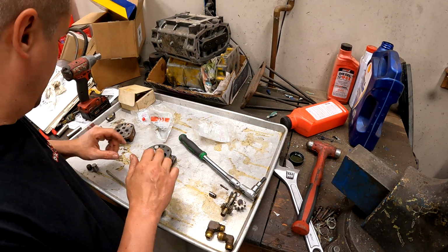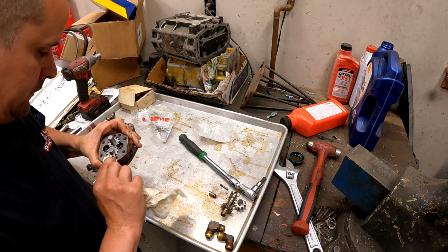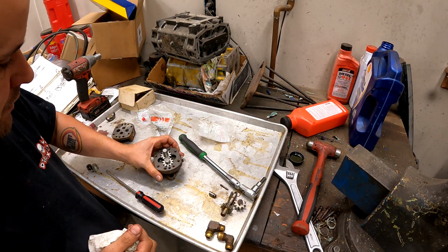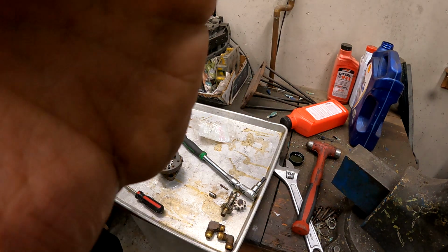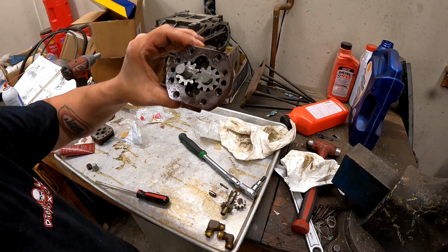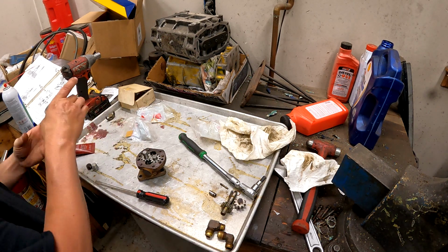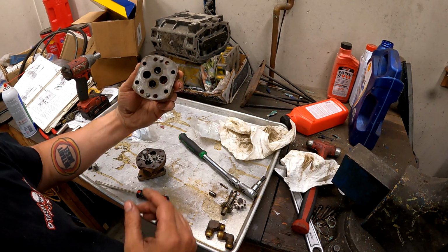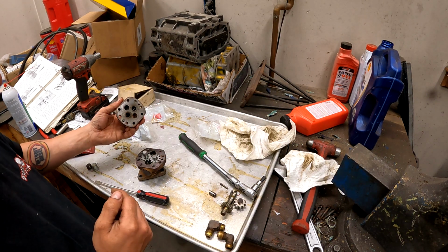We're just gonna lightly dab it on around the outside of this thing. That'll seal her up and that'll be good. All right, well, we got our Loctite 515 on there. Ready to go, just a super light coat. This you don't have to worry too much about, it only goes on one way. There's only one end that's cut deep for the drive gear.